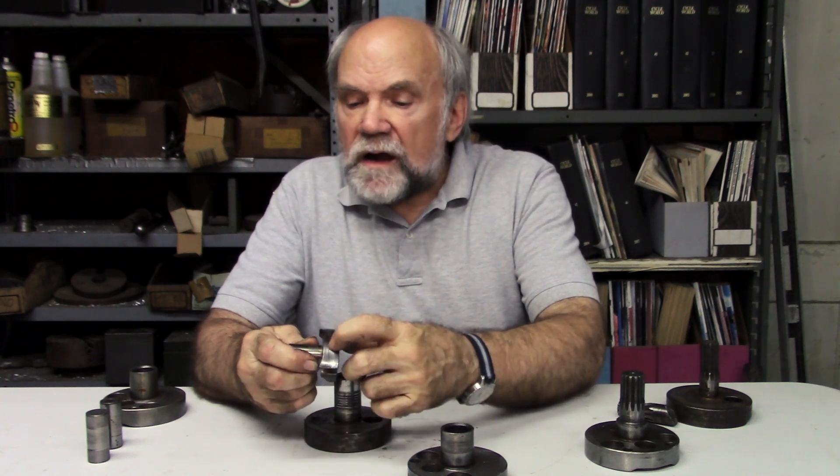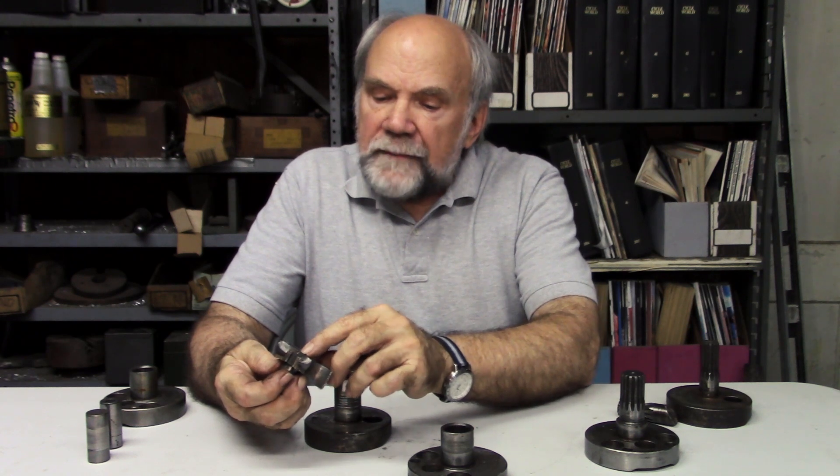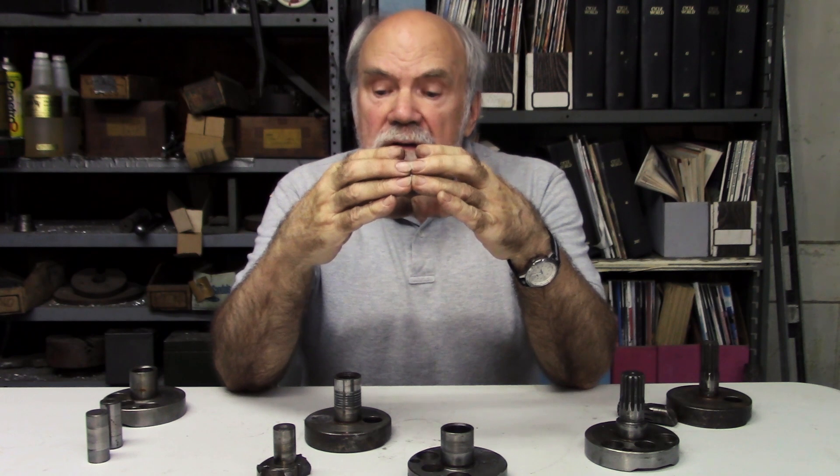It would open up inside your crankcase like a pair of brake shoes. See these marks? Those were made in the half second it took for the crankshaft to stop turning when it flew to pieces. The little failure came from this fillet. It spread across these fracture surfaces, and what had been one solid forging — which looks so durable — broken in two.